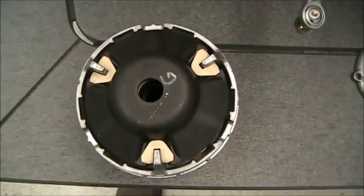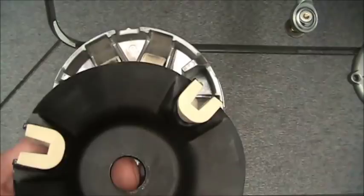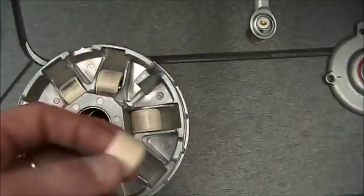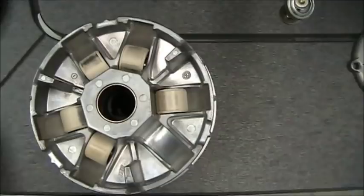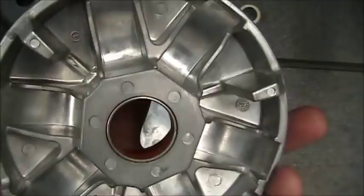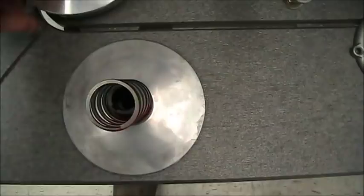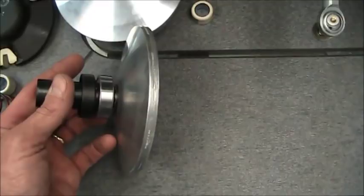With the primary clutch off, we're going to dissect it. It is based on a roller-style clutch like you'd see on a small ATV or scooter. The steel cover up front has ramp angles that effectively act like the angles on a normal ramp in a flyweight clutch. Inside you've got rollers — each roller is hollow, and that determines its weight. The clutch has a red bushing on each side giving good support, so this is going to be a durable clutch that lasts a while. Underneath is the primary spring — different springs will be available in the future. Then you're down to the primary sheave, non-floating style, with a bearing in the center to keep the belt at tight tension and prevent squealing.